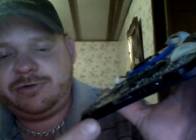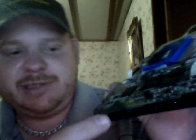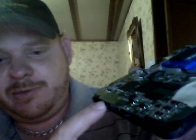Now for reassembly. Reassembly is just like disassembly. Be sure that you do not have an SD card in your SD card slot. If you have an SD card in there, it actually protrudes a little bit, and whenever you go to put it back together it could possibly break the mount that holds it or break your case. So keep this end down, the same as when we disassembled, and we're going to reassemble it.